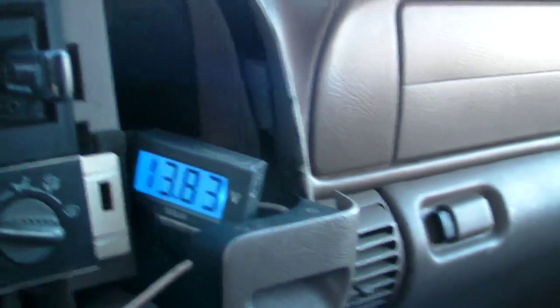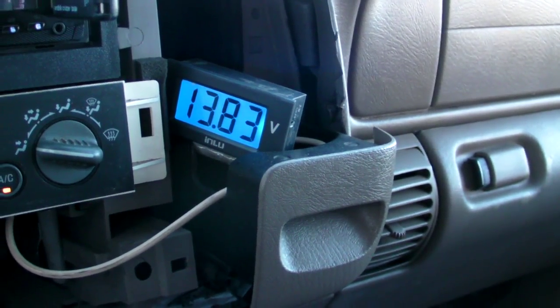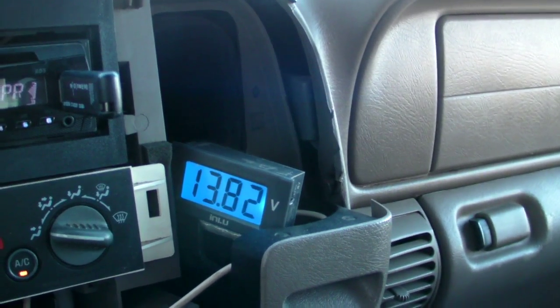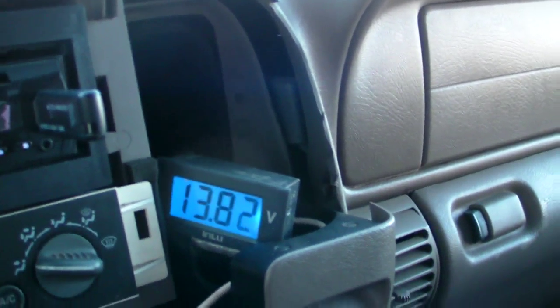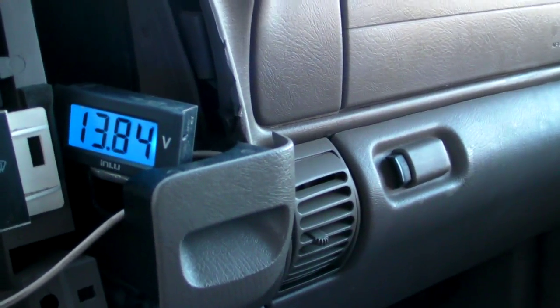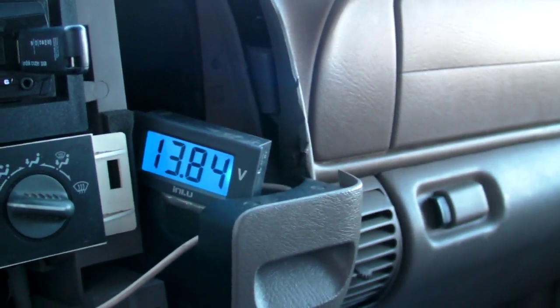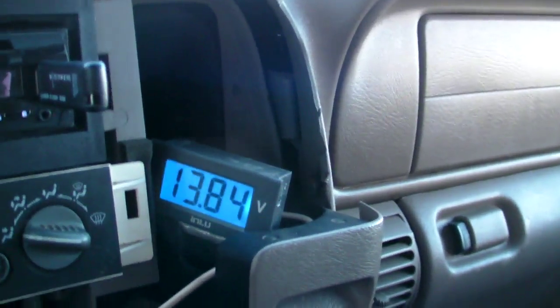As you can see, even with a high output alternator at 2,000 RPMs, voltage is still all over the place — as low as 12.2 on some dips, then the alternator kicks in, the load goes away, and it'll go up to like 14.2-ish. It charges at 13.8 pretty much consistently, even with temperature differences.